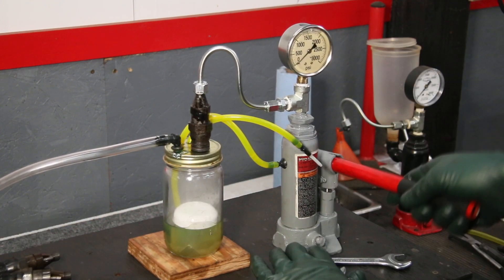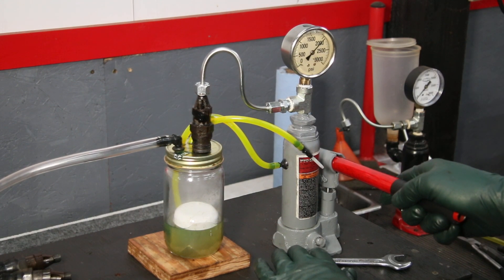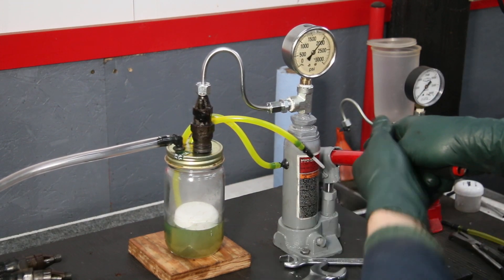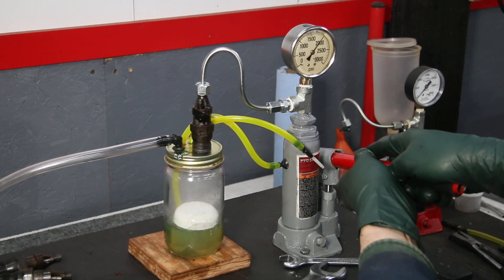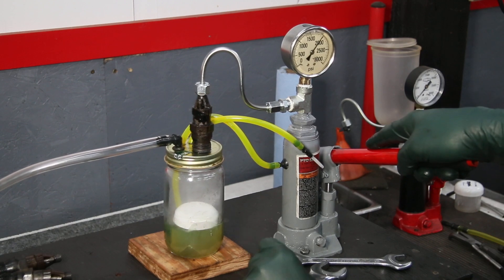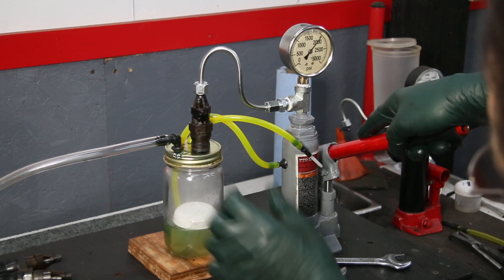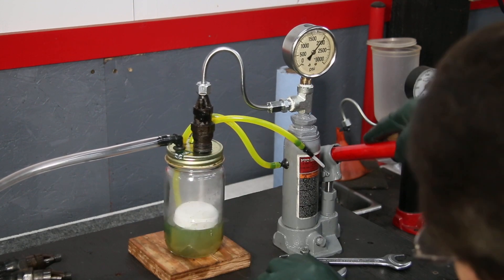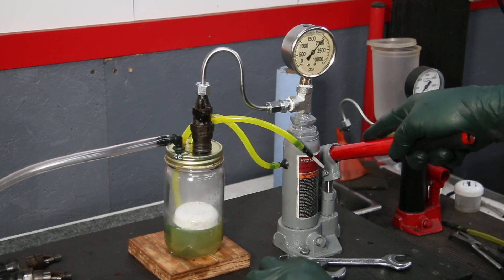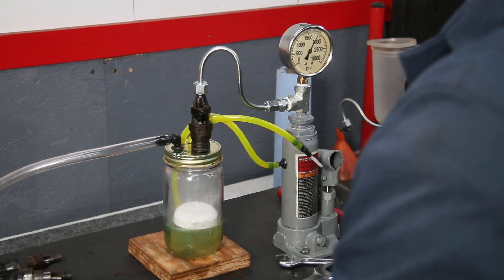Number four — watch the pressure. That one's releasing at about 2,050 psi. This one is pretty much squirting straight down, not a fan pattern — just straight down. It doesn't have quite the chirp that the other three had, so that's a question mark.